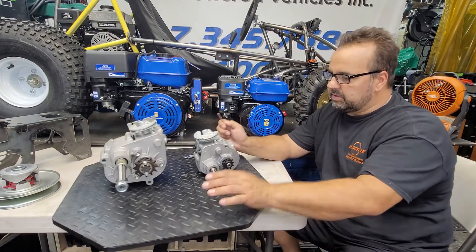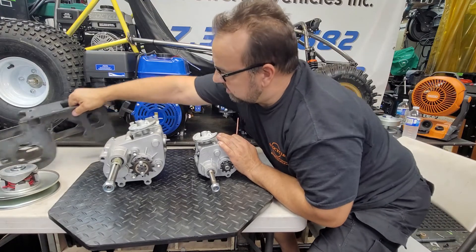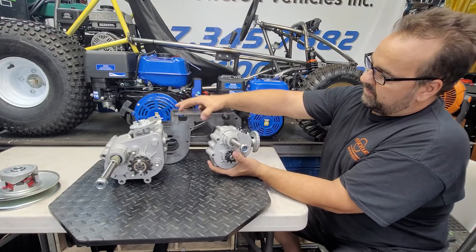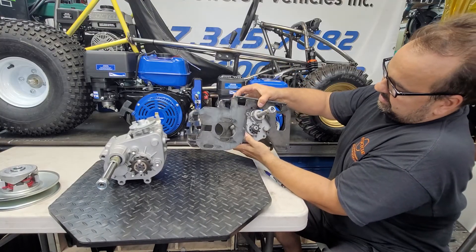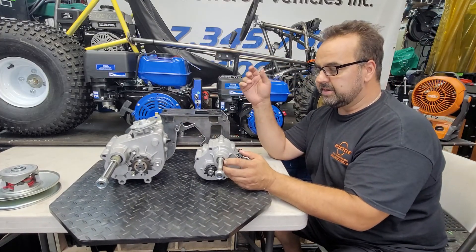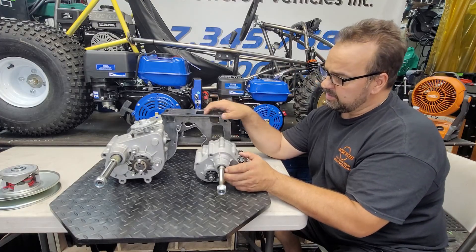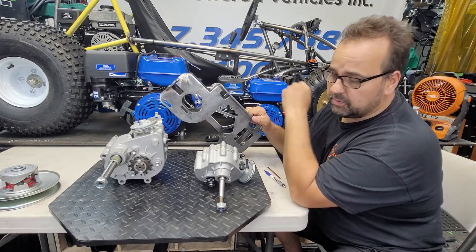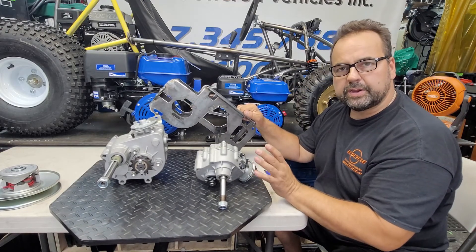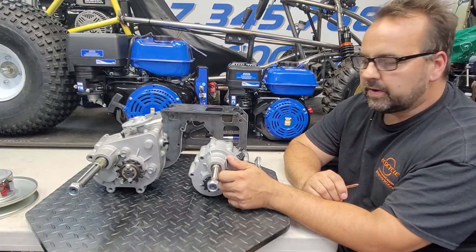The small-block power pack is far better developed. You can order a bracket today from ecocycle.ca and the gearbox fits right within it — comes with all the hardware and puts all your clutches on the correct centers right off the bat. There's also a provision for a jackshaft on the power pack bracket, which gives you an instant 3:1 gear reduction off the output driver of the gearbox.